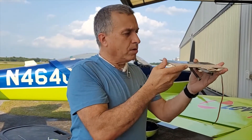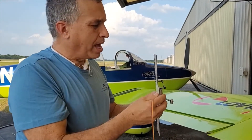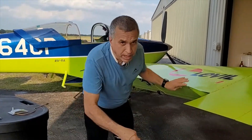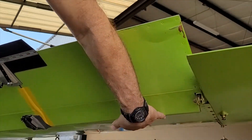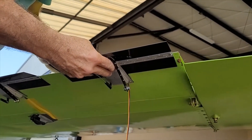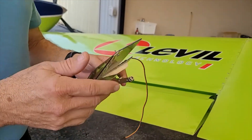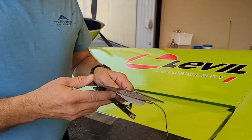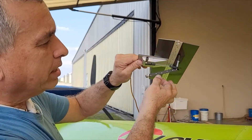This whole thing weighs about five ounces. In airplanes that have a counterweight at the fore edge of the aileron, you should complete this counterweight with the proper trim tab weight so the aileron is balanced. You should always balance your flying surfaces when you install the trim tab. So we've got the servo, the link, and the counterweight.